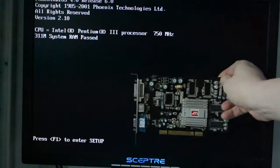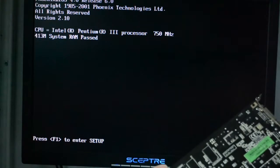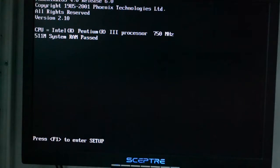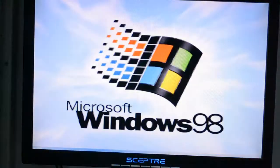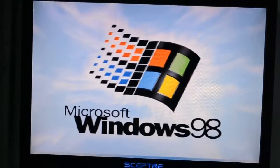This is the card I was trying to use. Just an ATI R9250 128 meg 64-bit DDR. Yeah, this might be too new of a card to go in there. I have an AGP card that's a little bit more of its era, but yeah, the AGP slot is missing. It has the ability for an AGP slot, but it's missing parts inside. That's the thing that happened with a lot of these pre-built computers, is they would save money by leaving out parts that you might not need. If it wasn't available from the factory, they would leave that part out.